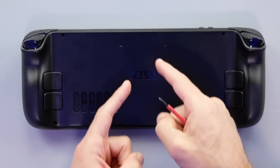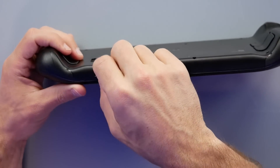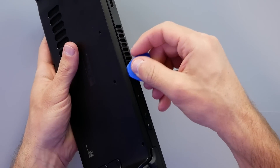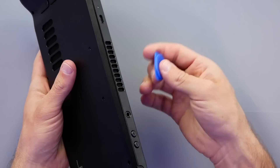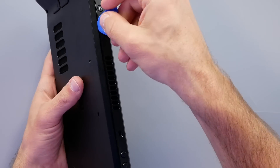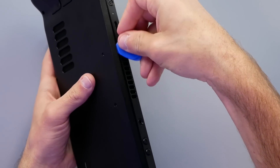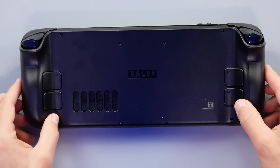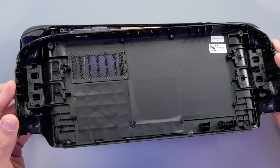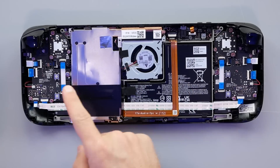You don't want to take a longer screw and go right through the middle here - you could actually run into the motherboard. All screws out. Also don't forget about your SD card if you have one in, since the case kind of goes around it. As expected, they do have clips holding the plastic casing together. Just use a plastic spudger, or an expired gift card or credit card - something softer than the hard plastic and thin enough to sit between and push the two edges apart. It didn't take much to get this backing off, just a quick run of the spudger around. No broken clips from what I can tell.